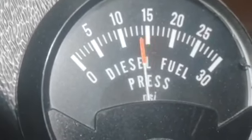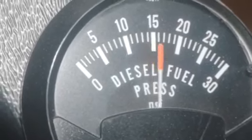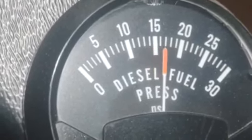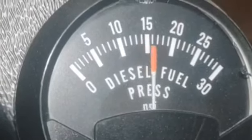If you have fluctuating fuel pressure like this on a fuel pump and you have already checked all of the basics — fuel flow, no source of restriction, clean filters, good clean fuel and that kind of stuff — one possible cause can be that the spring will have gotten stuck over the ball, the check ball, and worn a groove into it.